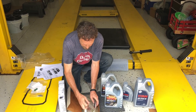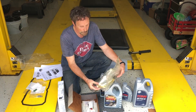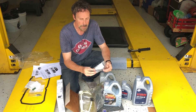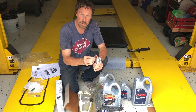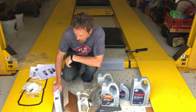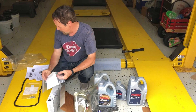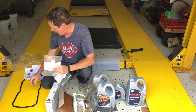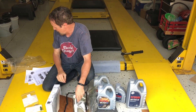You want to have a pump that can pump the fluid - this is the pump I ordered before, it basically goes in here and you can pump through this hose into this tool right here. You're going to need this filler adapter that goes into the pan of the transmission to fill. Make sure you've got the filter itself, a new stand pipe, new bolts - these are one-time use bolts - and of course the seal for the transmission pan.